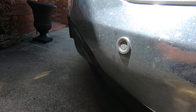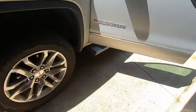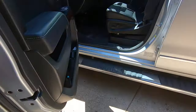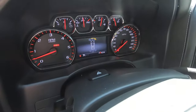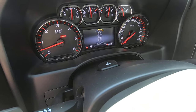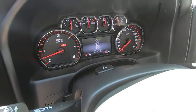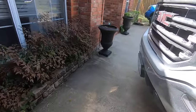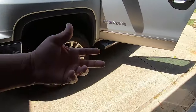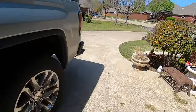With the engine running you could sometimes hear these sensors with your ear — I can't hear these. The engine has to be running on this vehicle for them to be active. Right now I've got it in reverse, so both front and rear are active. The display is showing it's picking up a right-hand object and a little bit in front because I'm close to the house. These should be pulsing at about a one-second rate, so I'm going over to the rear because there's not as much engine noise.